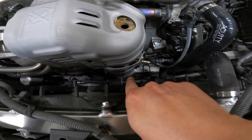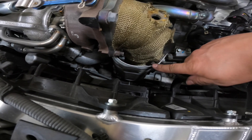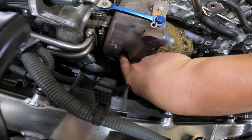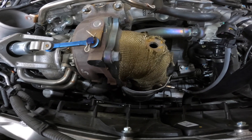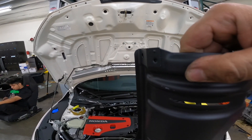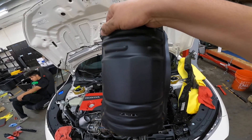We're running into a little bit of a situation. The heat shield is held by four screws — one here, one down here, one on the other side, and one that's hidden right behind the turbo. Our option is to remove the downpipe to be able to reach it. Three of them are accessible in this orientation, but the one that sits right underneath the turbo manifold is causing the issue. I really hope we can get it on.